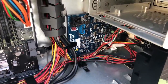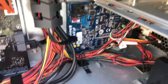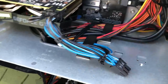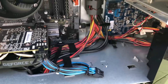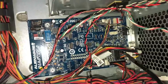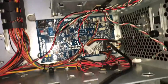Let's talk about this little secondary board, or daughter board. It looks complex, but it's actually the board that controls the lighting for the chassis. This was a concern initially because I wasn't sure if you could just plug everything in to a new main board and get it working. It turns out that this mini board is powered by a Molex cable, of which we had plenty, and a standard USB cable connects it to the motherboard — any motherboard. After putting everything together and wiring it in, it all lit up.